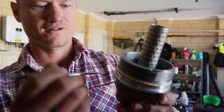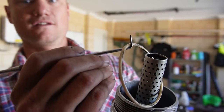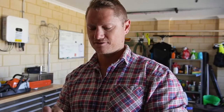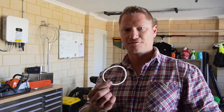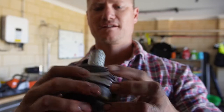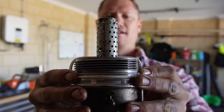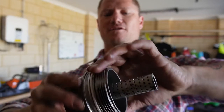The first thing I'm going to do is change out this o-ring. Very gently come in just underneath the o-ring like so, nice and gently lever it off. Give this o-ring seat a bit of a clean with the rag — just a nice quick wipe out. For the new o-ring, I like to get a little bit of fresh oil on it, just run it through your fingers like that. Grab your cap and sit it inside the seat for the o-ring, nice and easy, just run your fingers around so it sits in there nicely. Give it a good lube up around the edges as well.